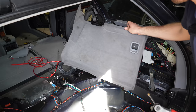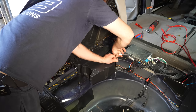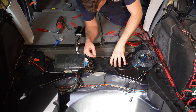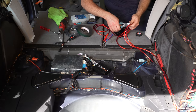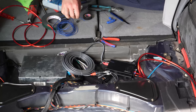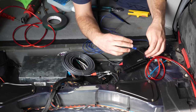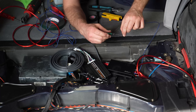That's the positive hooked up. The negative cable is a bit too short so I extended it using the red wire. I've found a way to put the cover back over this without messing up the wires. The amp for the sub is going to go in here — the holes line up with the threads from the chassis, and I'm going to use double-sided sticky tape on the back to absorb vibrations. The DSP is going to go right here with double-sided sticky tape. This is the ground — battery is disconnected by the way. Now we have this cable to connect the DSP with the amp for the subwoofer, plus the blue remote wire that connects from the remote terminal to the DSP.